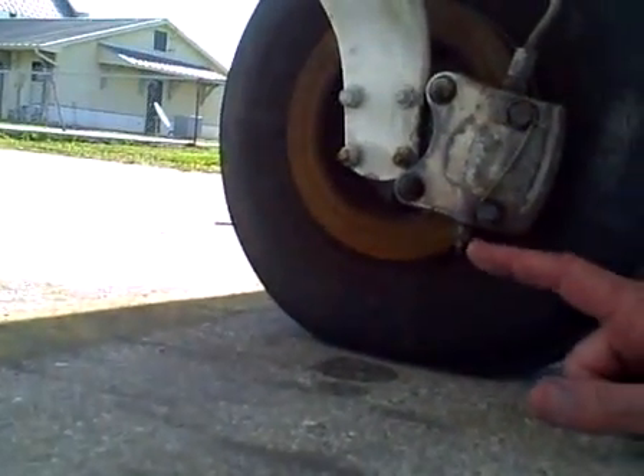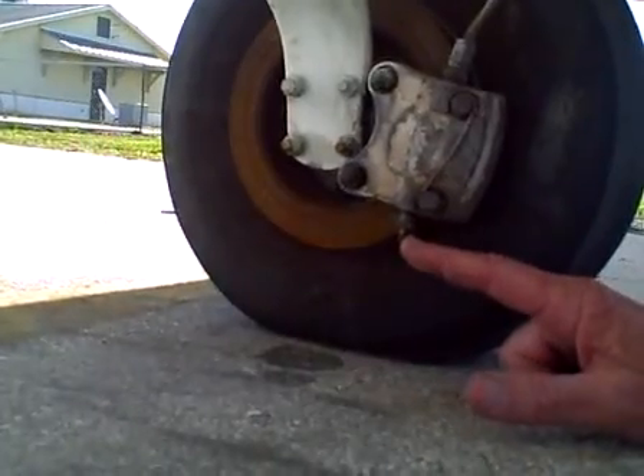For pumping your brakes on these Pipers — they do give you a lot of problems. First, you have to come around to your Piper at the brake pad area and get to this fitting right here. The fitting is like an automotive fitting with a Zerk nipple, but there are two fittings here: the master, which you don't fool with, and then the actual drain. If you look really close, there are two little fittings — this is the nipple you have to loosen up. Loosen that nipple with any kind of wrench, about five to eight mil. Do not loosen up the master — it comes as one unit, like an automotive, but with two little units.